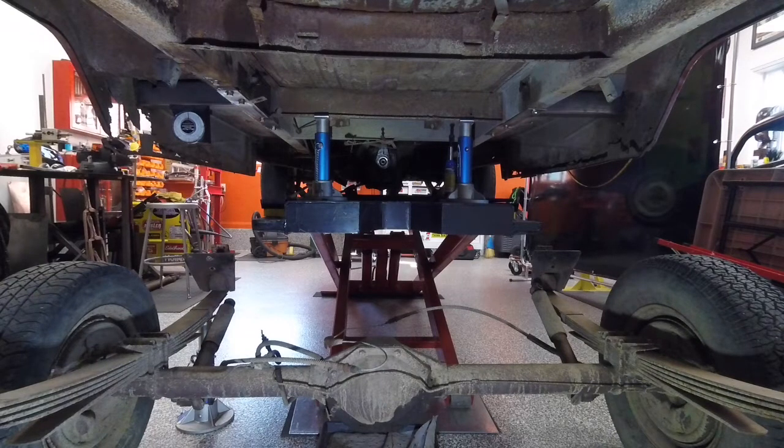What I'm going to do now — and I won't video the shackles going on — is put the rear shackles back in place on the leaf springs. That way I'll be able to lower this down knowing it's lined up, and then allow the saddles on the front to mate up with those three-inch box sections. Once I get that done I can go ahead and mark it up to get those lined up right. Those box sections are just tacked at this point.